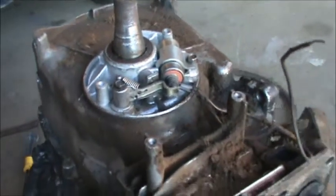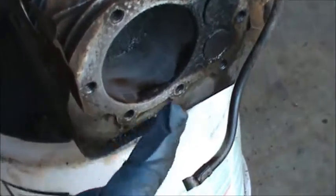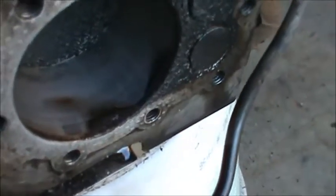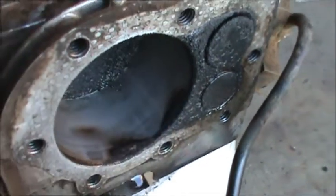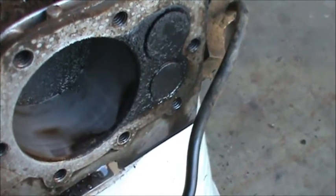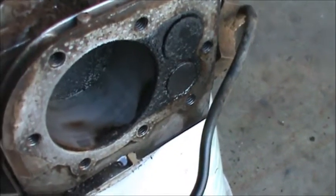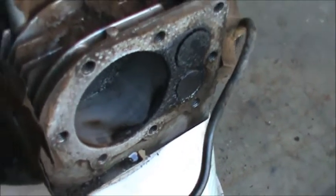Points are an antiquated system. If we look in at the piston, you can see there's definitely some scoring here — that's the problem. Some oil is getting past the piston and getting burned. I think the machine ran out of oil, so it's pretty much shot.